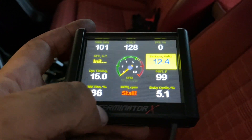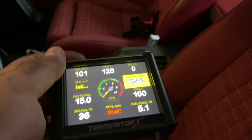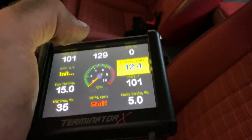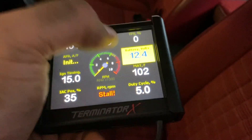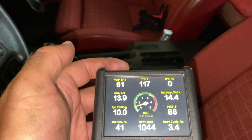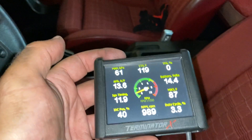We are all hooked up, fired up — let's see what our volts are at. The test I want to do: we're at 12.4 battery volts. With the previous stock alternator, the engine would be running and we'd see about 12.5 volts — and it should be much higher. As you can see, we're now at about 14.5 volts, two volts higher than it was with the stock alternator.